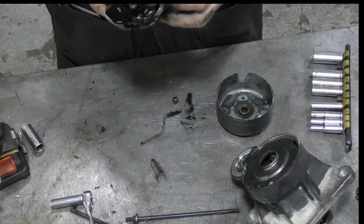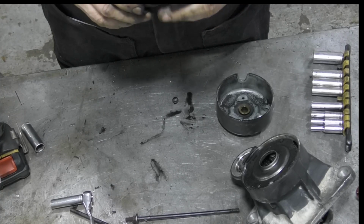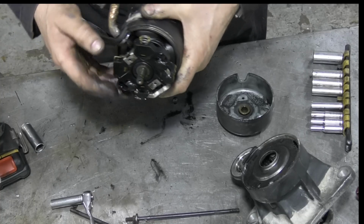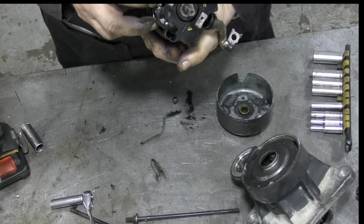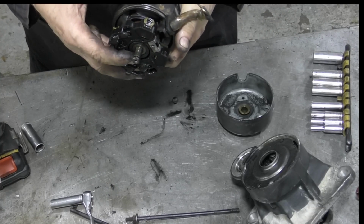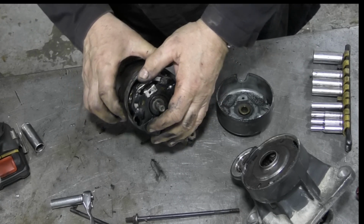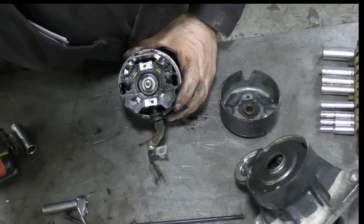This is one of those very clever Bosch starter packs. You know, brush pack, should I say, not a starter pack. And the wires. Oh, I see. The wires are soldered onto here. Now, what's the brushes like and what's the commutator like? Well, we don't know. But this seems to be kind of an easy repair because there is just one solder joint